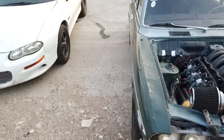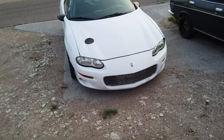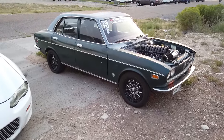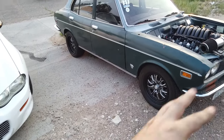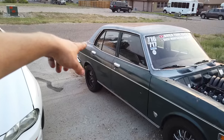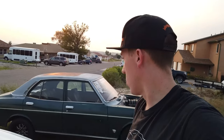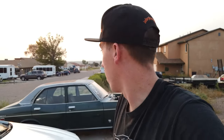Had a lot of miles right there from race week. Old Salty's out here too — battery is dead, got a few things planned for that. Clyde is at least back together and should be ready for many more miles. I'm going to get another seal and carry that socket with us just in case. The car does have a weird vibration because the driveshaft's never been correctly balanced. I really think why the seal came out was because of that fuel pump going out — the car was shuttering and bucking at the track, which probably shocked and tore that output seal.